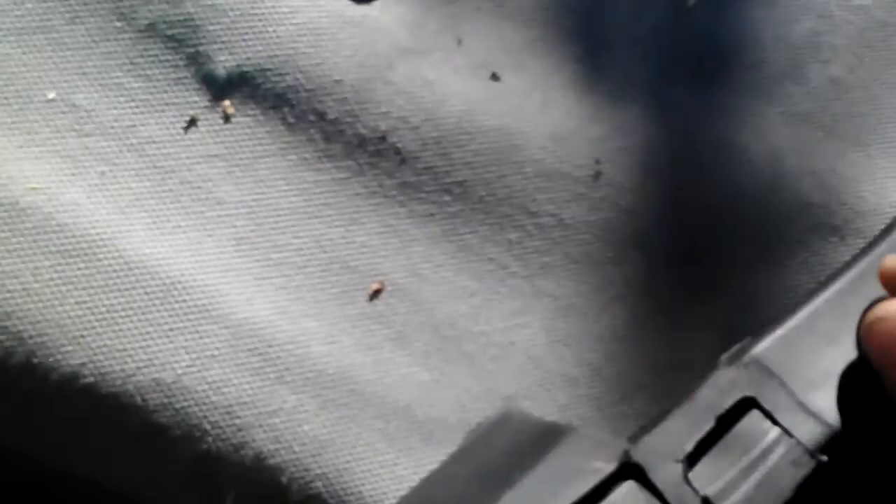This is a trick I learned off Eastwood.com — get you some sandpaper. This 60-grit is too rough, I'm not going to use this, but just for example: you go to the back of these trim pieces and look in the light — see how that's real shiny? You want to sand them boys on down. You can put it on a little two-inch disc and hit it with the air, but I'm just going to do mine by hand. You want to rough all this up. See, I took that shiny down — shiny up here, dull right here. You got to do that on all the back.